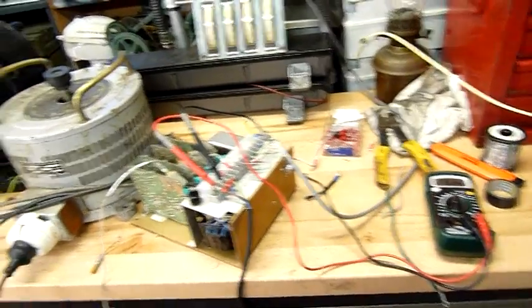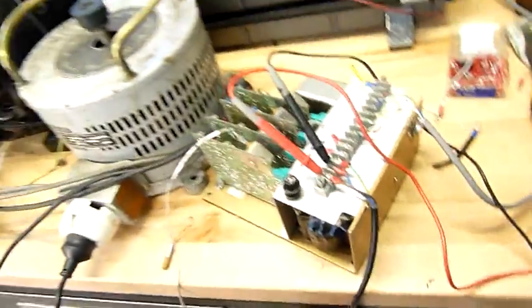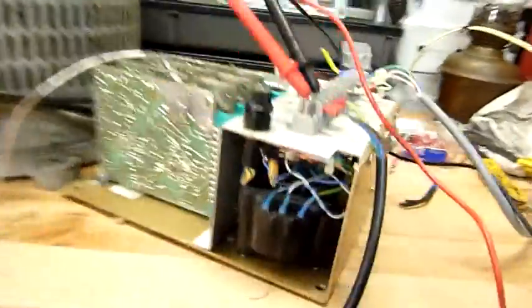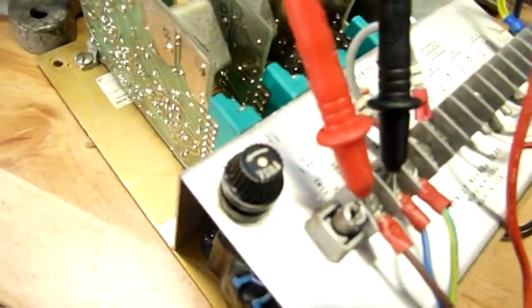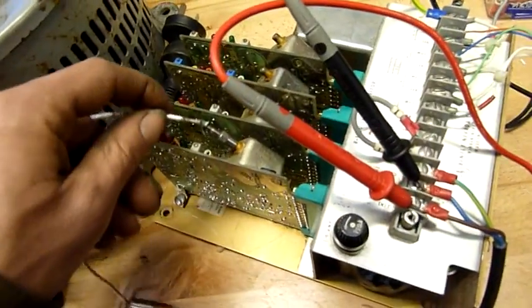At the moment I'm just trying to get this damn vibration monitor to work, but it's not even powering up. LEDs aren't lighting up for more than a second. If I just sort of touch the mains on and off they do flicker into life, but if I leave it on it doesn't do anything. I'm running it on 115 volts, which is rated 95 to 125 VAC. Maybe it's because I don't have all the sensors hooked up.